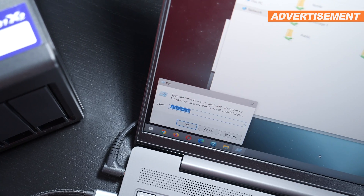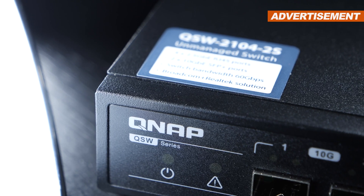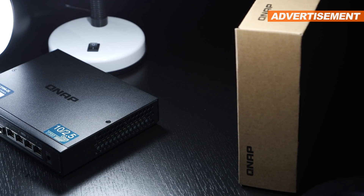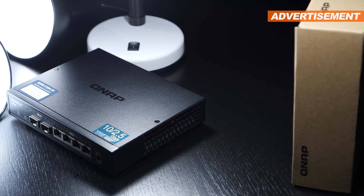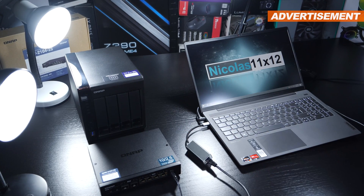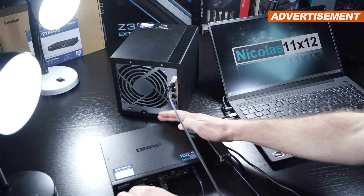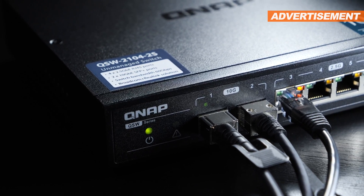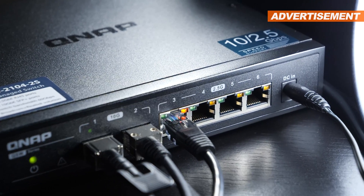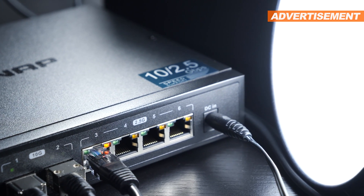Now generally speaking, who needs a network switch, and what can you use one for? Starting at the router or modem, imagine your device only comes with 4 LAN ports. Your home, or you on your own, need like 6 or even more for your PCs, laptops, TVs, consoles, and so on, and imagine you don't want to rely on Wi-Fi. A simple and straightforward way to get rid of the issue is to get yourselves a switch helping you extend physical ports. As for managed vs unmanaged switches — managed switches allow you to go for extremely detailed manual configurations, whereas unmanaged does everything automatically. All we need to do is plug something into the ports and we're done. So for most of us, including myself, unmanaged certainly is the way to go.